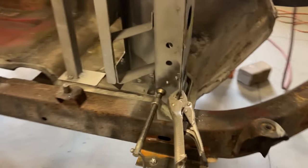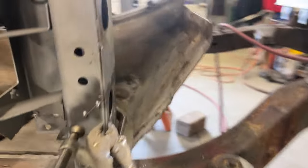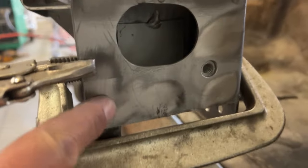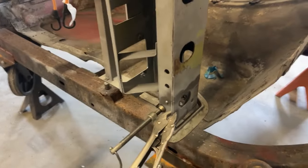What I'm going to do now is finish welding this patch piece in — come down here, cross this seam, get that tight, spot weld this here, and then I'm ready to stick this rocker in.